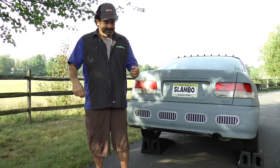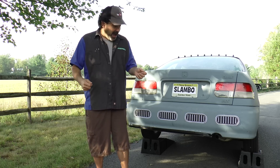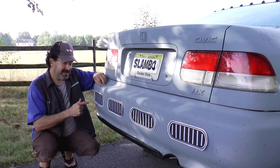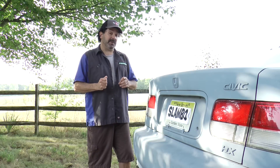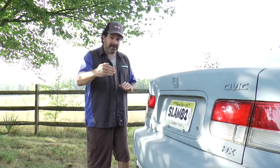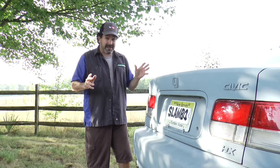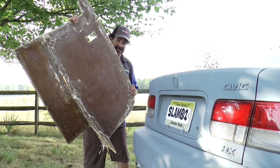The drag racers were getting more miles per hour on the top end because airflow is moving through the car, or so they say. I looked at this situation and thought there's got to be another way — I'm not putting holes in Slambo's bumper. I put Slambo up on the ramps to take a look underneath, and it didn't take long to figure out it would be pretty easy to build a belly pan. You can just add a simple flat belly pan, or add strakes and turn it into a diffuser. I started with the belly pan — went under there, cut out pieces of cardboard, taped them together, then went a little overboard with fiberglass. This was the end result: this crazy monstrosity.